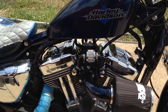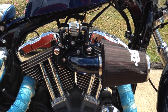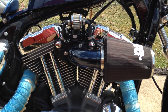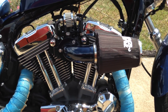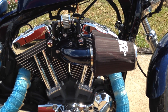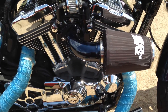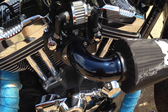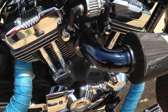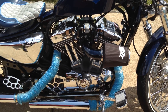I've also done a head breather right here, which reroutes the oily crankcase air and vents it out so it cools your heads a little better. I've also done a 636V forward-facing air cleaner with the K&N filter on it. I actually helped name and possibly design this air cleaner — at least the elbow part of it.